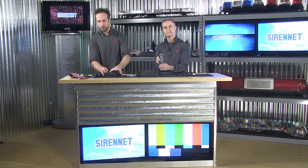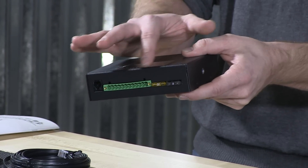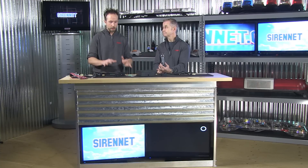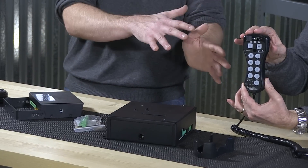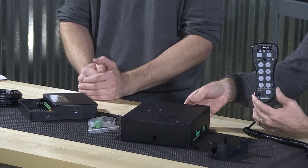That is a product that is tied in with the Star family of light bars and traffic arrows as well, so it'll only work with Star's traffic advisors. The box that comes with it on the 881 is designed to interface with the harness and connector from the TA, and in turn this will connect into the main control box, which will allow this control head to activate the unit for you. If you are not needing to interface one of Star's traffic advisors with the system, the 880 will be the version that allows you to have normal buttons for lights, sirens, and slide switch as well — just without the interface for the traffic advisor from Star.